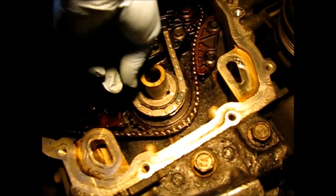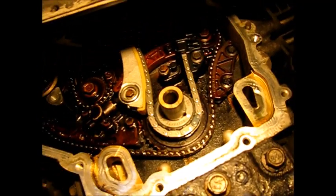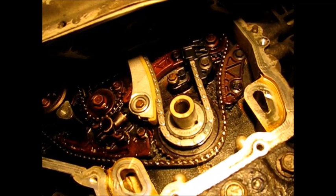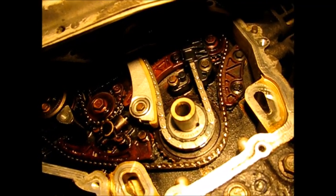This chain was loose before in the tensioner — I could move it. So it had gone ahead and activated right on install. I never had to hit it with the push deal, just pushed in a couple millimeters with a screwdriver.